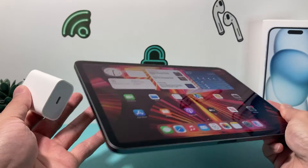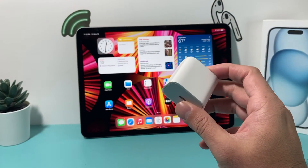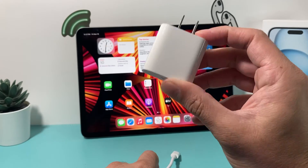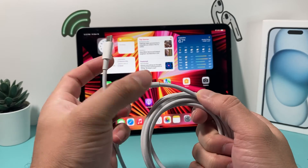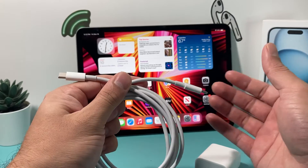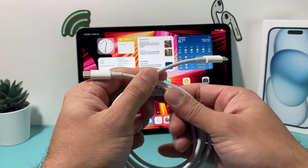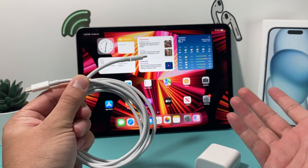After cleaning the port, ensure that your charger cable isn't defective. When it comes to charging your iPad Pro, there are usually two parts: the wall adapter, which can sometimes go bad, and the actual USB-C cable, which can wear out especially near the ends. Apple cables aren't always the greatest. Try using a different cable if you can to see if that helps, because sometimes cables break and don't deliver enough charge.